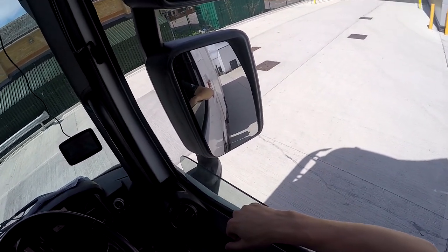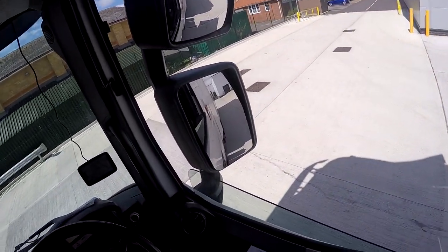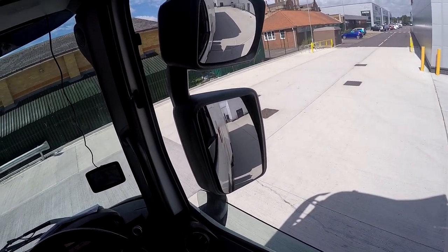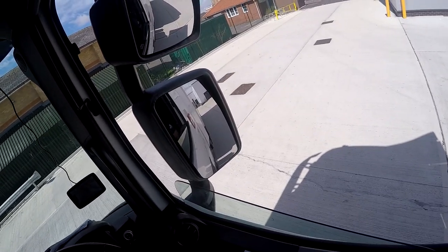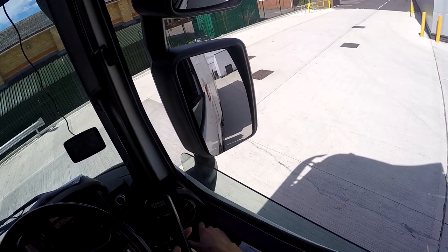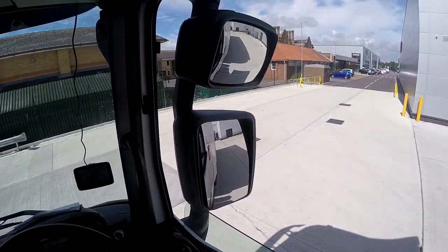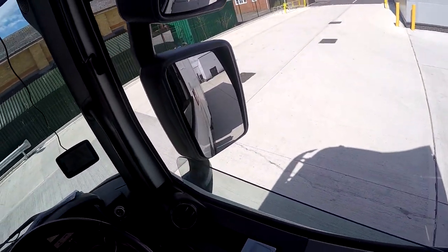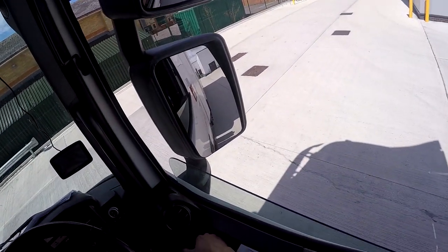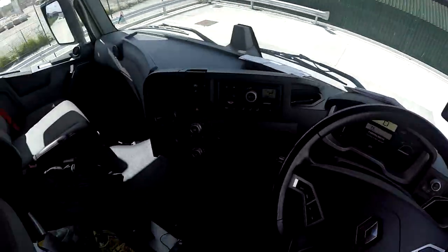This is the important bit that a lot of people don't remember to do. Slowly pull forward — but we're not pulling fully out from underneath the trailer, we're just pulling slightly forward. You'll hear the click of the kingpin coming out of the fifth wheel. Then lower the suspension — press the minus. All that's doing is just dropping the trailer on its legs slowly, instead of driving out and potentially damaging the legs. It's doing it nice and slowly. And there we go — that's actually uncoupled.